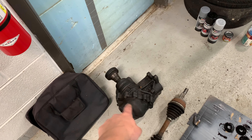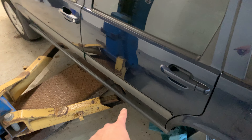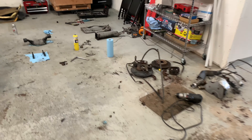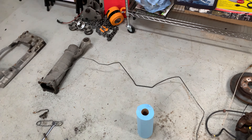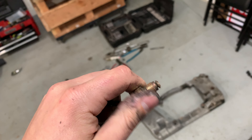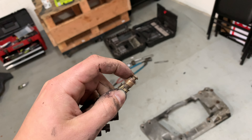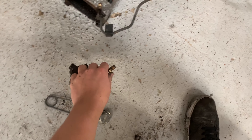We probably need to rebuild the angle gear soon too — I think I'm going to run the stock angle gear just to get things driving. Hopefully we can get this V70 out of here soon. There's a brake line under here that's different than the 850; it's $40 new from Volvo, probably even less at my business discount. There's also a brake line that runs across from the rear subframe — about $20-30 for that line so I'll just buy a new one. Unfortunately one line got a little messed up, so I need to buy a new nut, cut it off, and re-flare it — I think it's just a bubble flare.